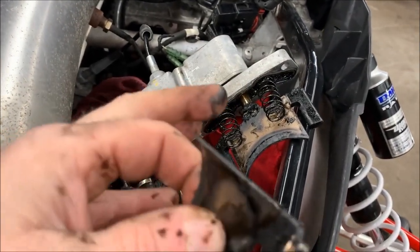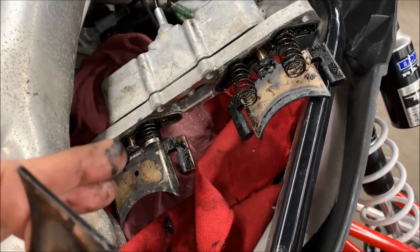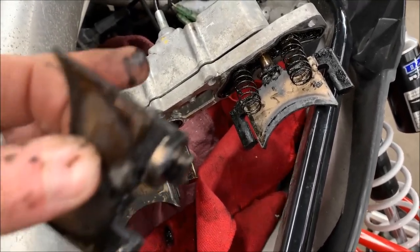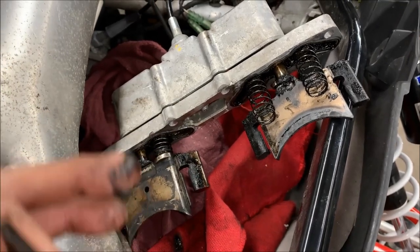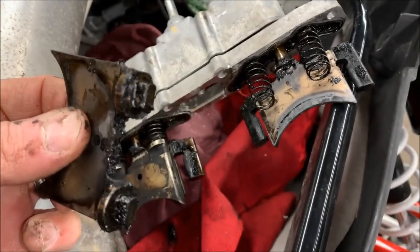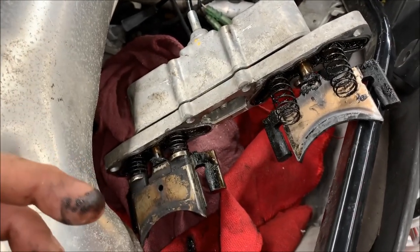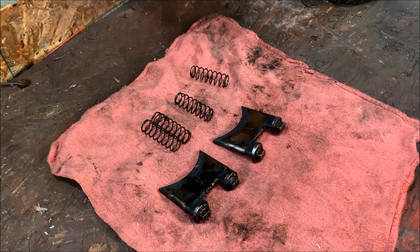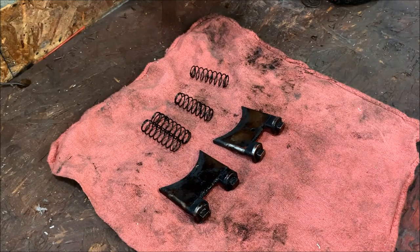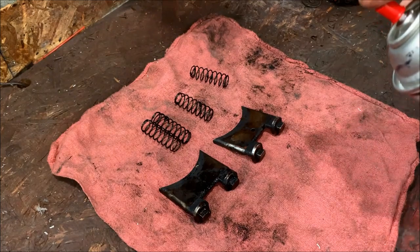What we're going to do now is clean these in the sled — we're going to make a mess, so make sure you're using plenty of rags to clean up. We'll take these blades and put them on the bench and clean those over there, then take the springs out and do the same thing. We've got the two blades and four springs out here, and I'm just going to use brake cleaner to knock down the majority of the grease and oil off of them.